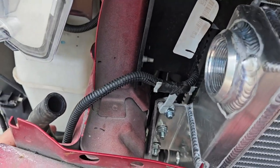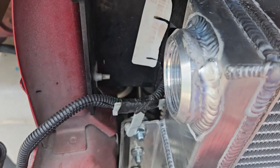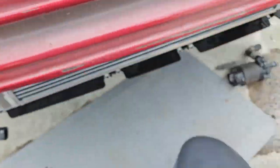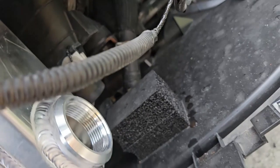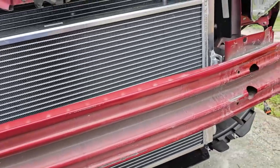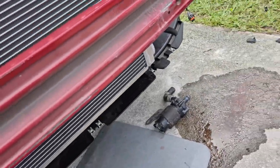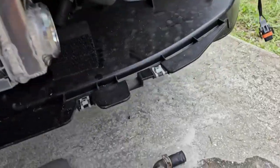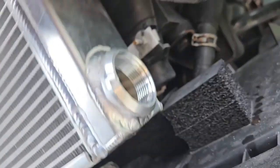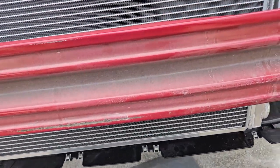I'll use a dash-20 AN to dash-12 AN push lock fitting, then run a little section of hose with a union and some clamps — same deal on this one but with a 90-degree fitting, which should run right to it. If you're using the stock hoses that should be pretty straightforward. The key thing you have to figure out is the intercooler pump — you can't just plumb this thing without the pump. I'll probably mount the pump using this hole in the frame right here, then route the hoses from there. I'll probably have to make a part two video for this since I don't have a local store that carries a dash-20 to dash-12 reducer.